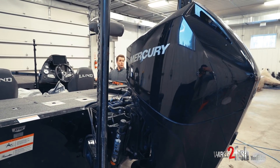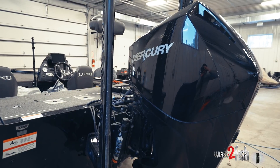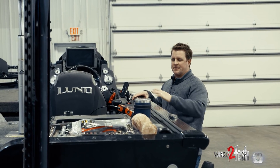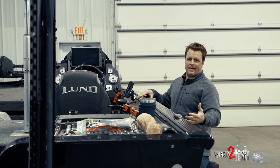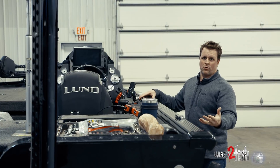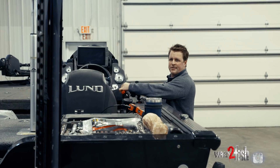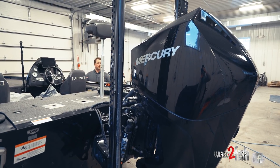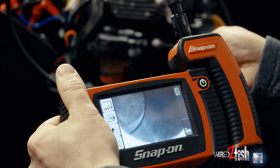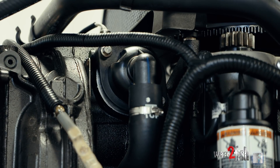We were just looking at our old two-stroke. Right here we have a newer four-stroke — this is a six-cylinder, 200-horsepower engine, and the same thing applies. The one thing you have with a four-stroke is a crankcase that has oil, whether conventional or synthetic. I'm going to do the same thing here — turn over those cylinders without starting the engine. I re-spread oil from the crankcase; whether you're running synthetic or conventional, it can tend to drain back into the crankcase over time under the force of gravity.